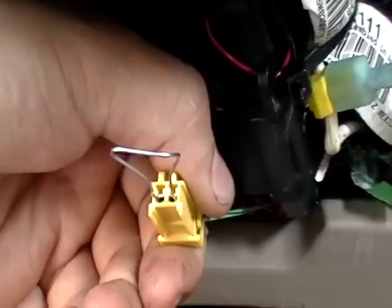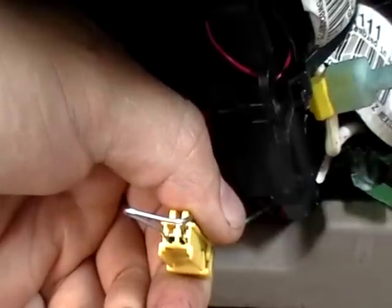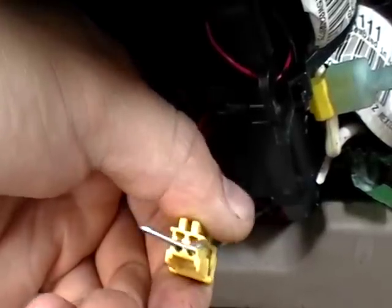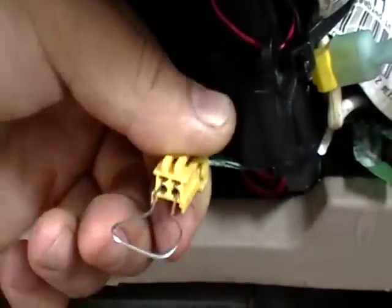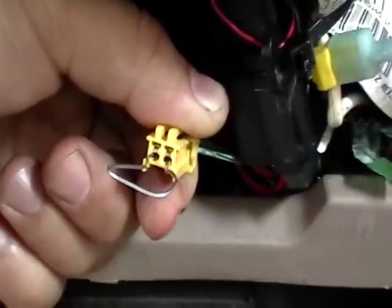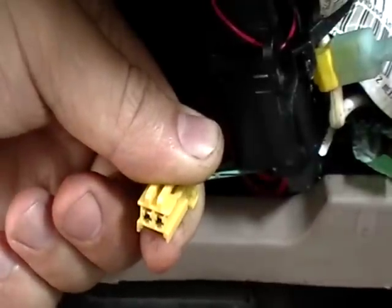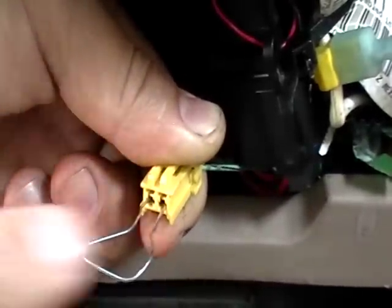So you have to have the light on, paper clip in, light off, disconnect it. And then when it's done resetting, it will just blink twice and it will go away. Ignition off — the light is still on. Now that light is off, we disconnect it. The light came back on, we connect it. The light came back off, we disconnect it. Then as you can see, blink twice and it's off.